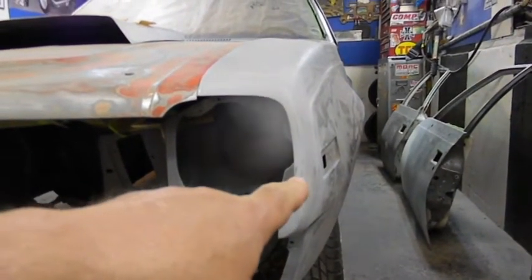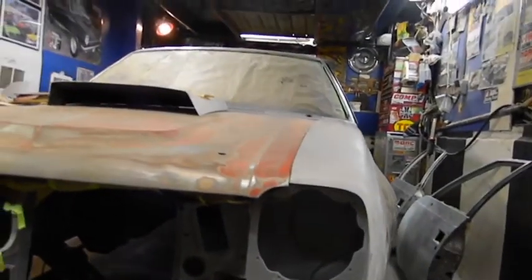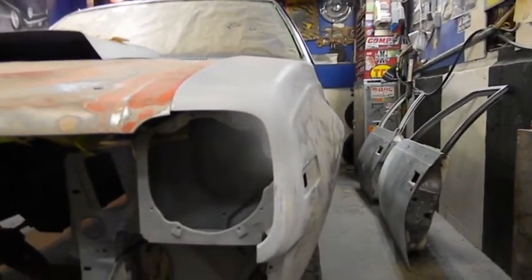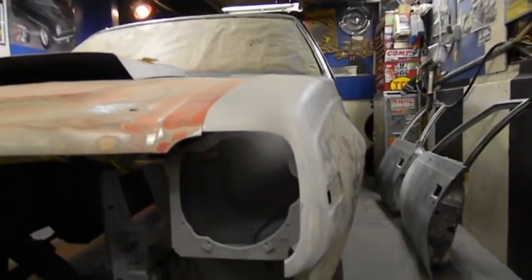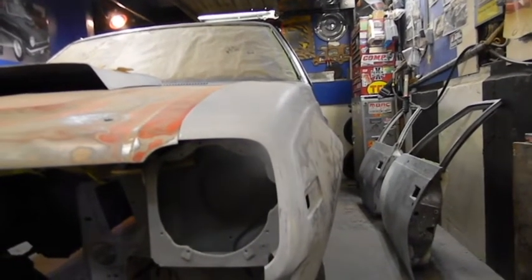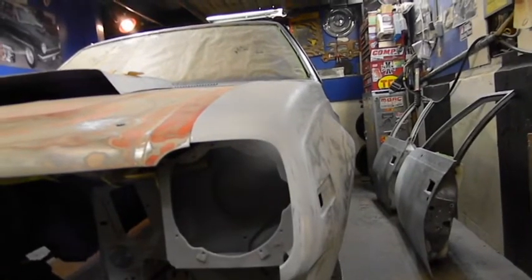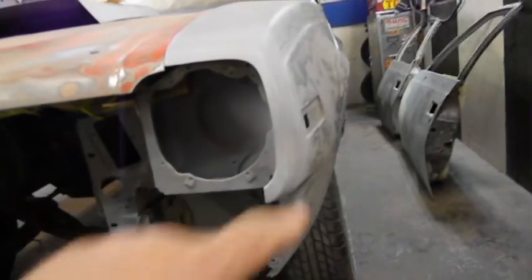So what I did was sand the scratch out. Once this thing's in high build, I don't know how long it'll be before I sand it — could be a day, a week, a month, a year, ten years, I really don't know. When it's in the high build and has that crust across it and you don't sand it yet, it's pretty much sealed. You don't have to worry about it. I caught that scratch with the bright sunlight on it.